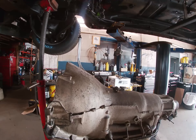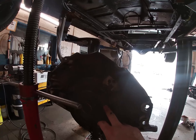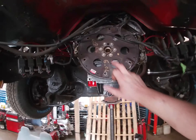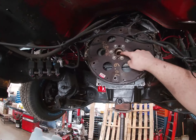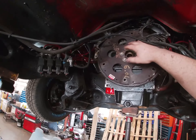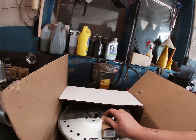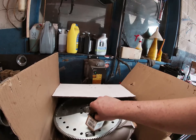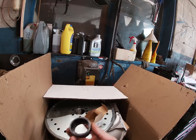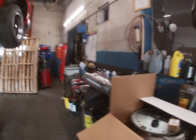So we need to give her a nice cut. I've never done this before. Here's my torque converter — a little tiny baby converter. I think the stall might be too high but I kind of ran out of money, so I'm just going to bolt her back in. This flex plate needs to come off — it's a 4L80E flex plate with the adapter. I'm putting my SFI one on and changing these bolts out because these are torque-to-yield bolts. I also got a PRW spacer to go with it. My mindset is: if you're saving two bucks there's no point — rather spend two dollars more and potentially get a better product. PRW parts usually fit nicer.